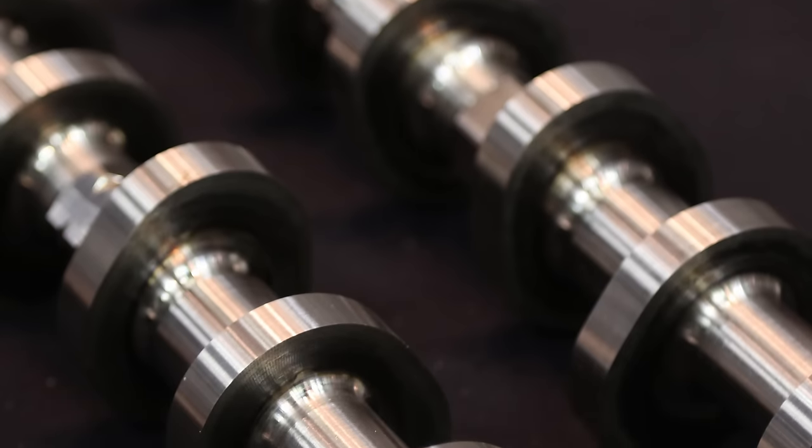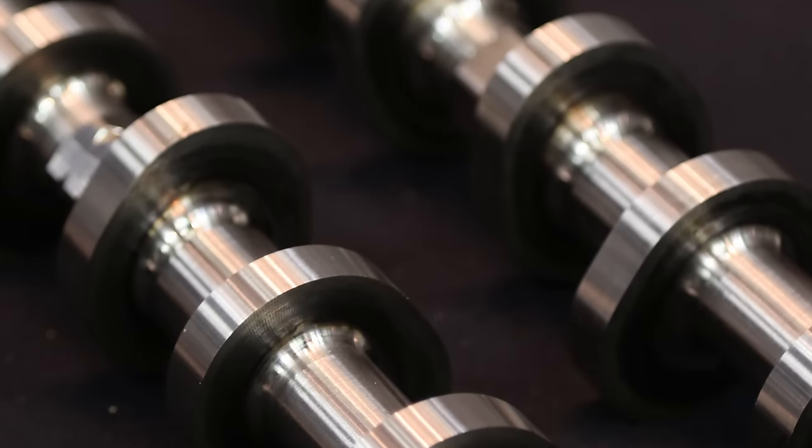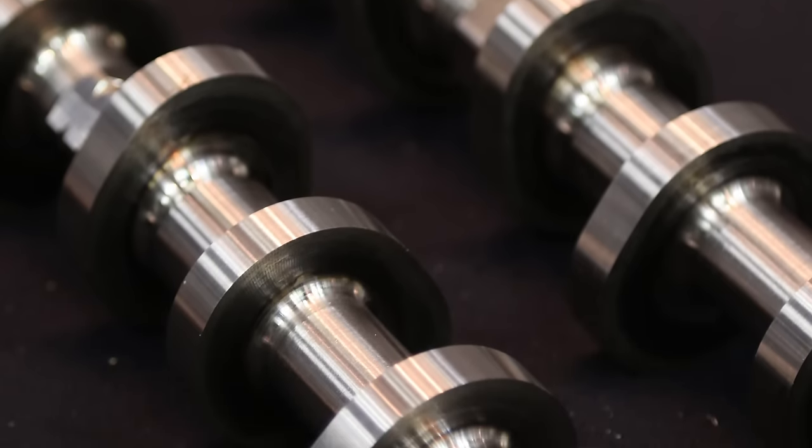With power adders, do you approach that design differently? Absolutely. The real nice thing about one of these engines is you can actually change the cam timing on the twin cam stuff without having to regrind the cam — that is a big advantage. There are a lot of different things that we're doing with that. The lobe profiles have to be different, and the lobe separation has to be different, so all that stuff comes into play.